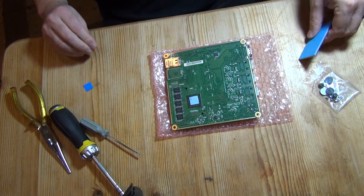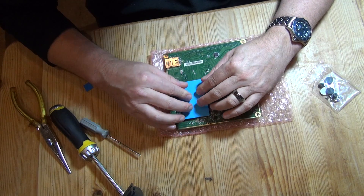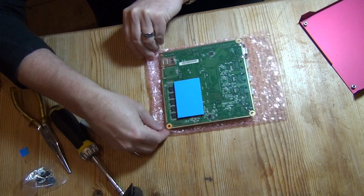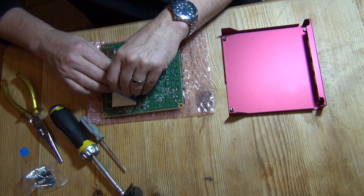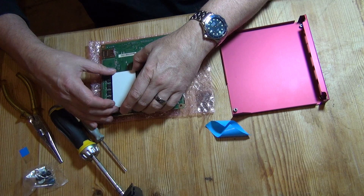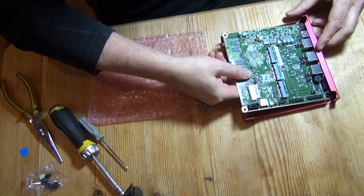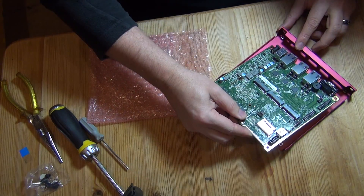Although it's a very simple build, you don't get a great deal of help and instruction, though there's a little bit on the manufacturer's website. This is me putting the heat spreader, which adheres on one side to the CPU. That blue strip is removable and reveals the adhesive side that sticks to the case. The board uses the metal case as a passive heat sink, transferring heat from the CPU through the metal plate via this adhesive heat sink material. You need to be careful to get this right first time, because once you're stuck on, it becomes a pain if it's not right.